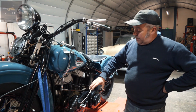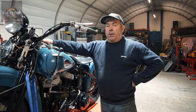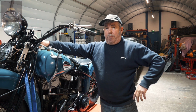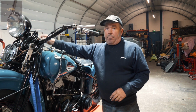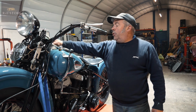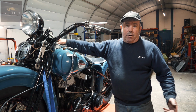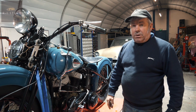If your crankcase is full up with oil, you don't want to put more oil in here, because it'll be overfilled. Once it's pumped, all the scavenge pumps are taking all the oil out, and then it'll blow oil out the cap and all sorts. So you make sure you drain that off first, put it back in there with a clean container or throw it away, and then top up your tank, as long as that crankcase has been emptied out.